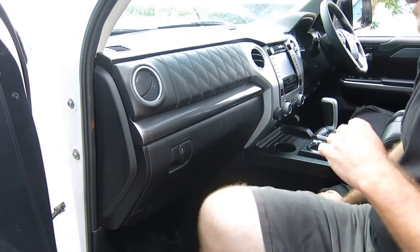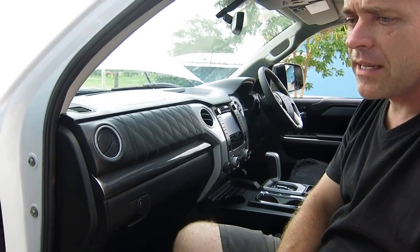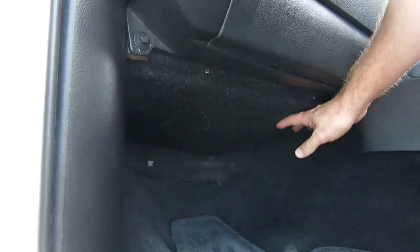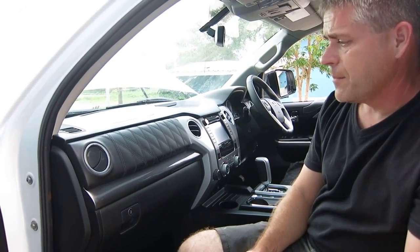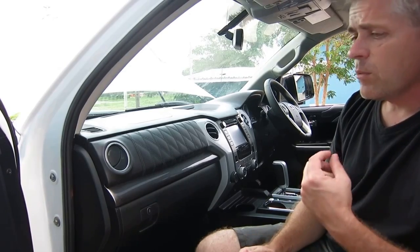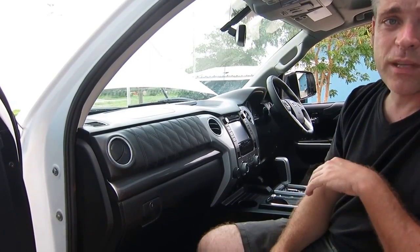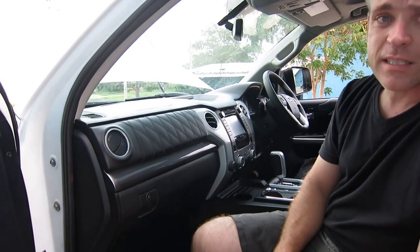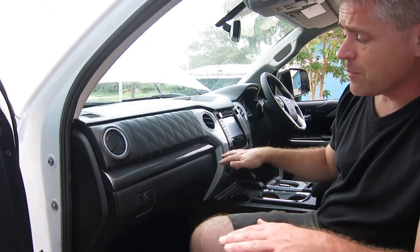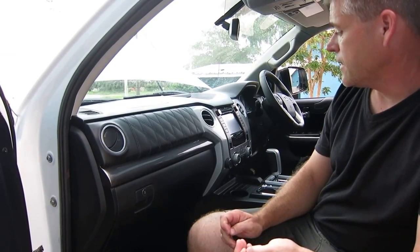Under the air conditioning unit inside the vehicle, we've fitted an undertray. That undertray is basically for two reasons. It's an aesthetic look - as you can see, this carpeted panel under here looks nice when you look under the dashboard. The second reason is it's a double redundancy for the heater box. If there is ever a leak, or you're getting condensation buildup because of high humidity, normally you would have water dripping on your feet. This tray is designed to trap that moisture and channel it to the outside of the vehicle. It has an external drain, and the tray itself is made from fibreglass with carpet on one side for aesthetics and a highly polished gel coat finish on the other side, so it's water resistant.